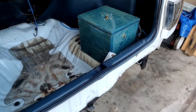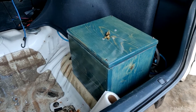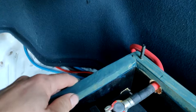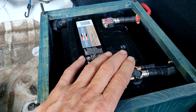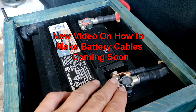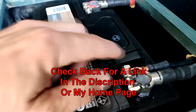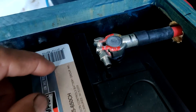Back here in the trunk is my battery. You'll notice this is not a typical box — I didn't really like the plastic one so I made my own out of wood with an outdoor polyurethane coating to protect it from moisture or weather, and I coated the inside with a truck bed liner. There's also a vent line running out of it through the frame. One of the important things when setting up a battery is your connections. I picked up these lugs — you drop the solder lug in, melt it with a torch, stick the cable in, and there's heat shrink on it to prevent corrosion. These have been on here for nearly a year and they still look perfect.